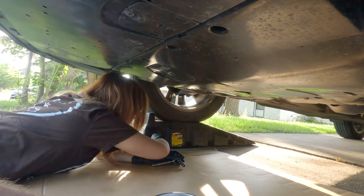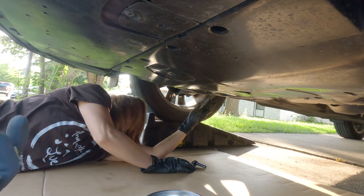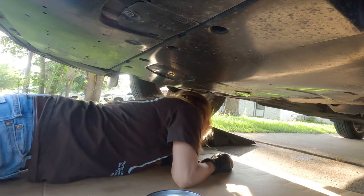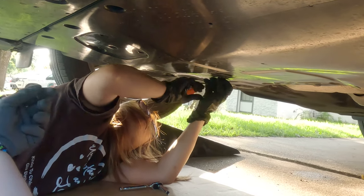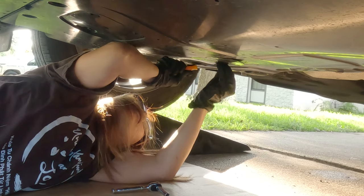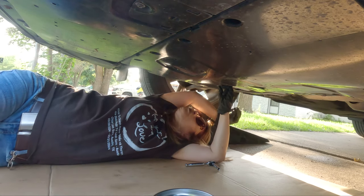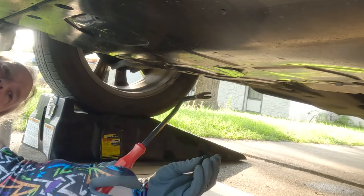Here's a little tray to put your screws in so they don't go flying anywhere. Those little push pins — they have like a center part that you pull down, and then after you pull it down you can just pull the pin out. You can use a pick like this: if you pull down on that center part you should be able to pop out the pin. Yeah, there you go. And there's another one over there kind of right above your head. This one is hard. There we go — trim removal tool.